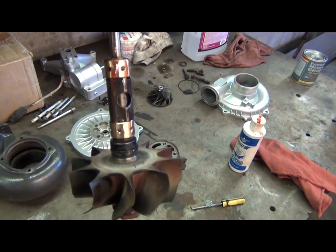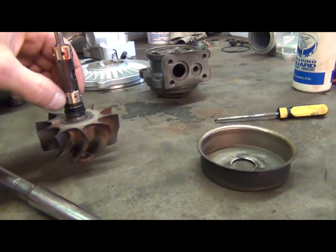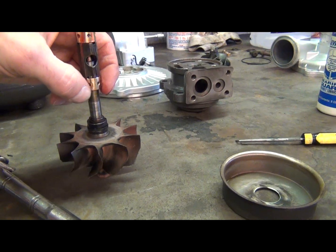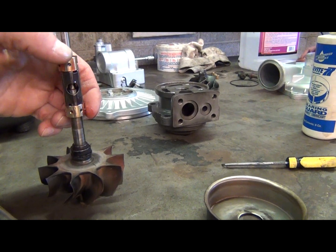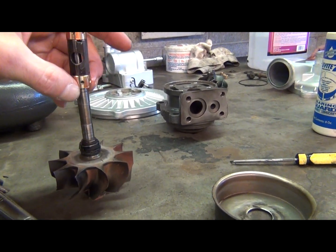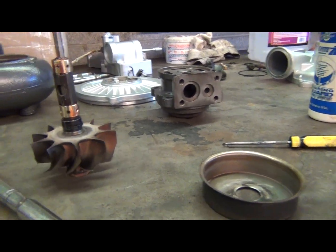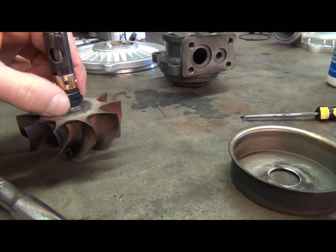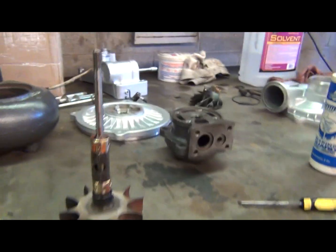On this piece here I've already slid my new bushings on. You get a new brass bushing — you can see that on the bottom. That spacer was already with the turbo and doesn't come in a kit, no need to replace it. You've got a new bushing right there — it just slides over this shaft: first this bushing, then that spacer, then that bushing. I've also replaced this tension ring already.